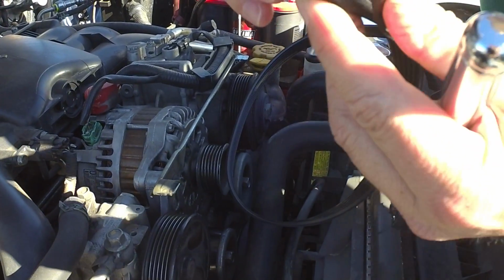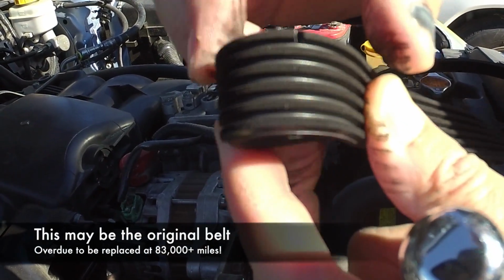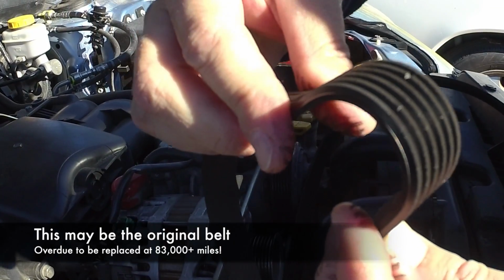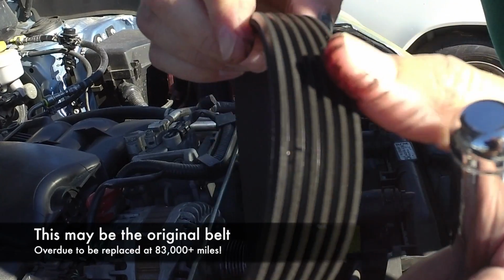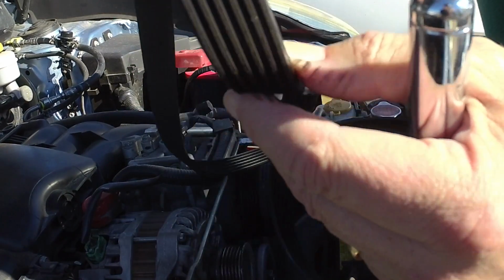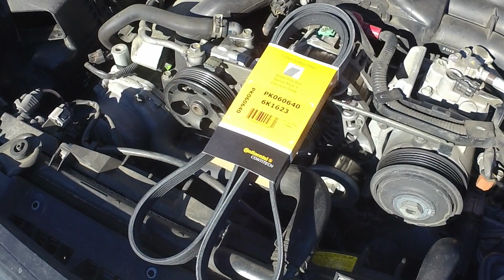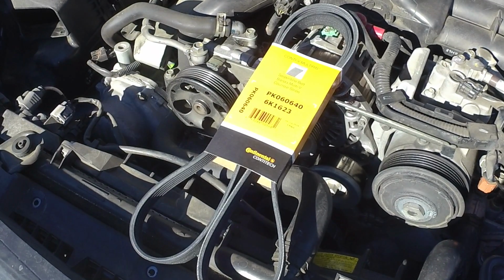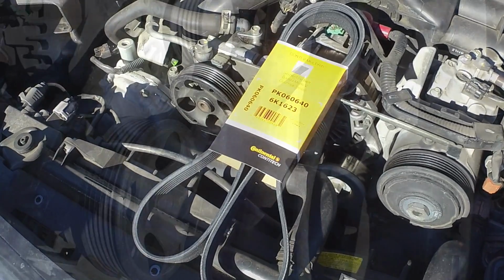If you look at it, you've got cracks. Can you see that crack? This belt is old. Definitely time to replace it. So here's our new belt. It's a Continental part. I'll put a link in the description and the part number.